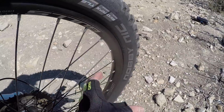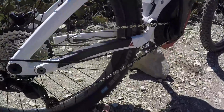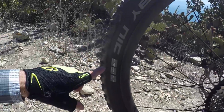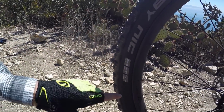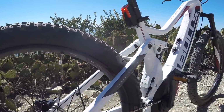These are tubeless ready, keep that in mind. They also are a little bit wider rims, and that's gonna give you more surface area here, back to those 2.8 plus size tires. Addix rubber, this is the new stuff from Schwalbe Evolution line. Apex reinforced for toughness and puncture resistance, and then this Snakeskin, so it's like this casing, so the sidewalls are a little bit tougher.